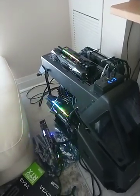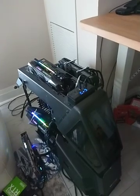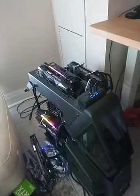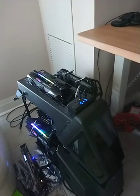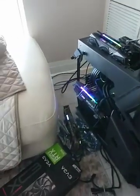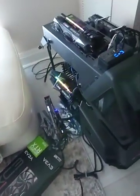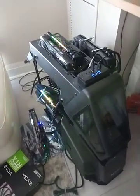For sure I can put maybe four heat sinks just on the main area where there are no holes, but I won't be able to spread them too much. If I decide to keep this, I'll definitely put some heat sinks in there and try adding a bit of pressure to see if it goes under 90°C. The ASUS STRIX actually runs very nice — at around 90°C, I've even seen it under 90. If I keep the room temperature around 24 to 25°C, the ASUS and MSI run at around 96°C, while the ASUS STRIX sits around 90°C — that's great, after doing the back plate heat sinks and extra pressure. So yeah, the 3090 XC3 Ultra is not a bad card. It's not the best either, but it's not bad at all. It's smaller and can fit in pretty much most cases.